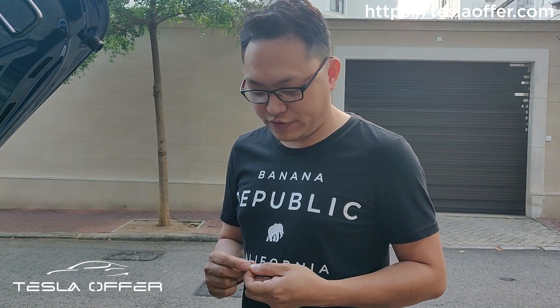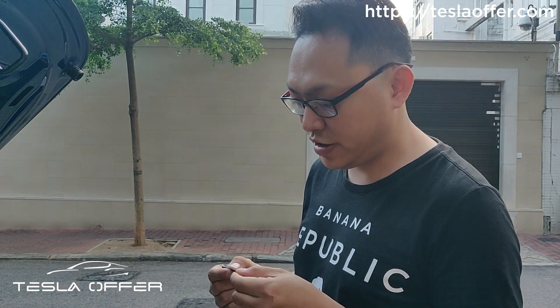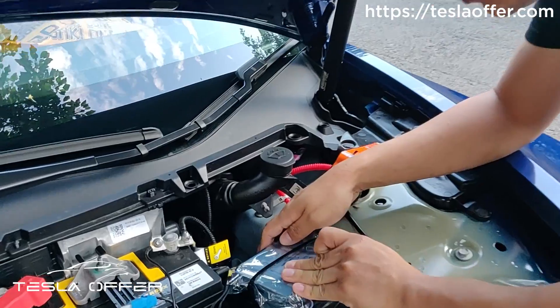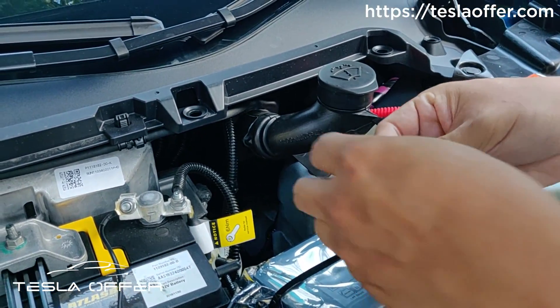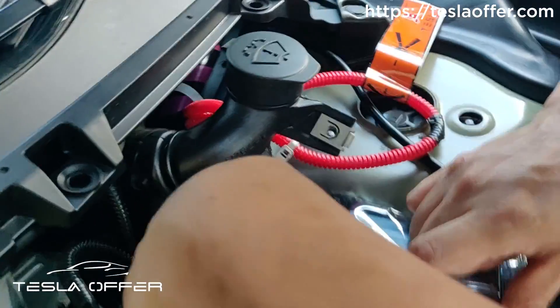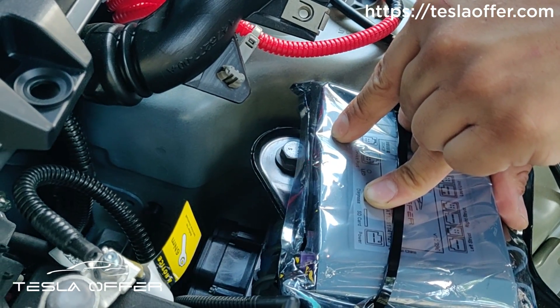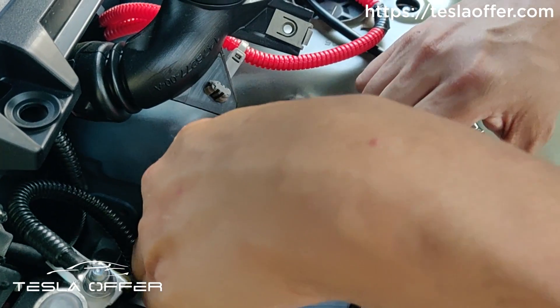To do this you need a software upgrade — we'll put the link below the video. After you download the file, put it into your SD card formatted under 32 gigabytes in FAT32 format. After you put the file in, make sure it's the silver box — that's our V2 system. Insert the micro SD card into the card slot. You'll see the light blinking; when you fully insert it, it will start blinking rapidly. Wait until it goes solid — that means the update is complete, and you can remove the card.